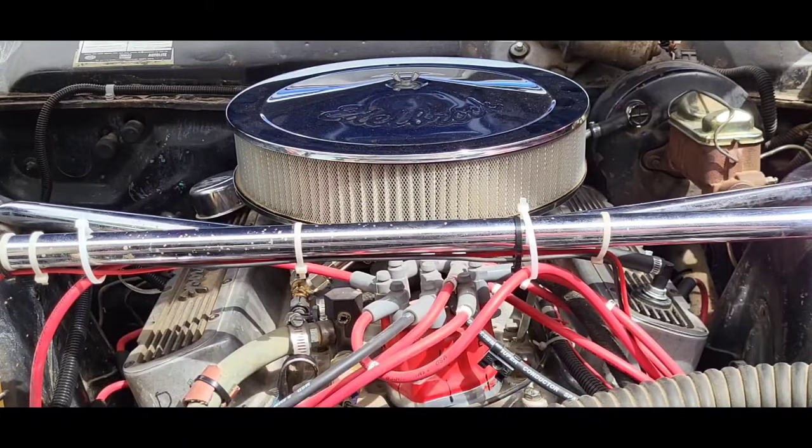Well, the good news is there's no valve train damage, no bent push rods. Rockers look fine. Springs, felt the back of the springs. Everything's fine on every single one. No bent push rods. Very pleased about that, let me tell you. But what I did find was that the number six hole, which on a Chevy would be the number three hole, the plug was just lying there.